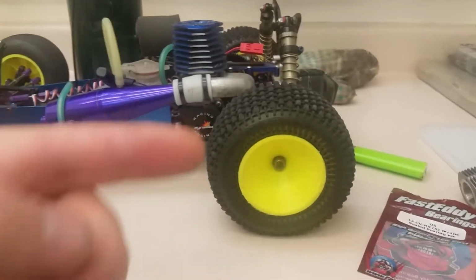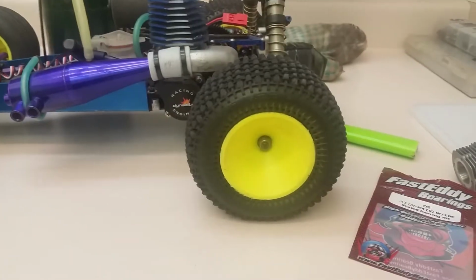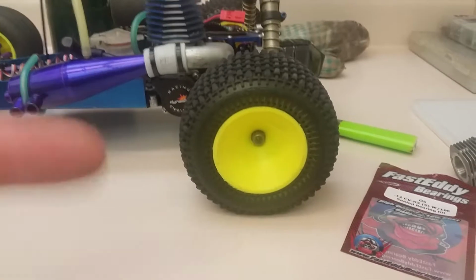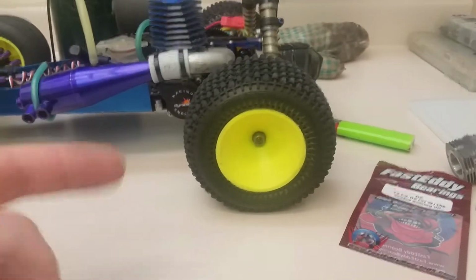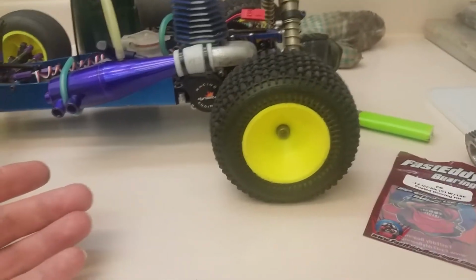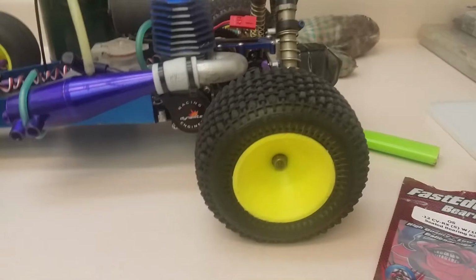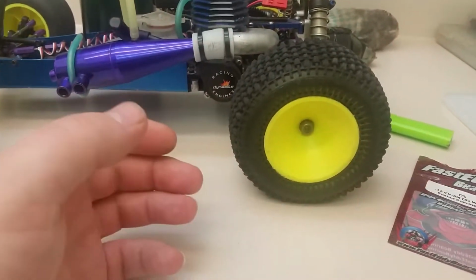What happens is the castor oil will glaze onto the shaft, and it eventually just polishes itself, because you have steel parts rolling against each other. It's like stepping on a skating rink. It's just so slick it can't grab. There's no friction, right? So what you gotta do is rough up that surface ever so slightly, and it'll grab, and it'll work every time for you. Here's another little quick tip.